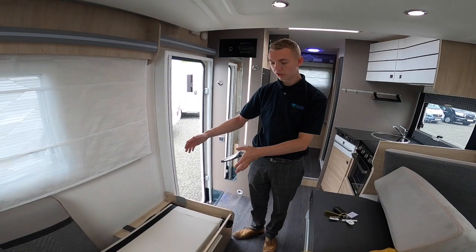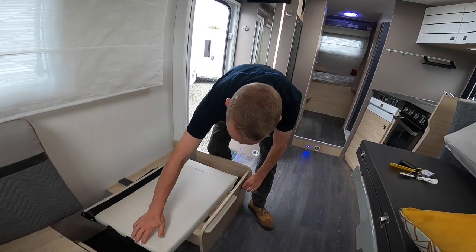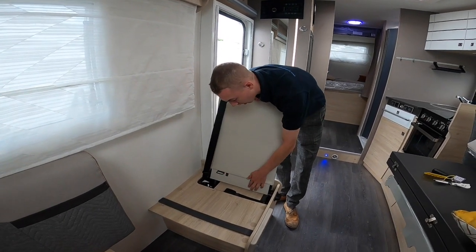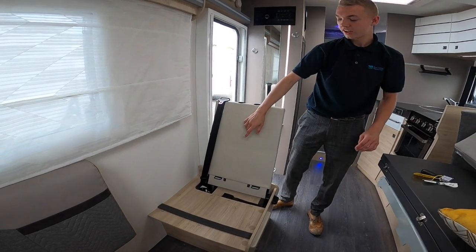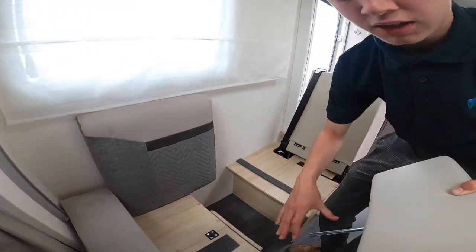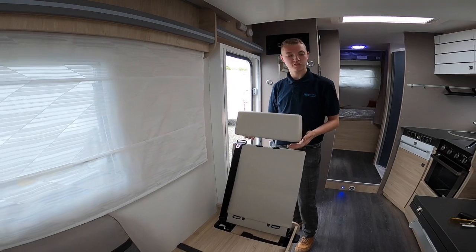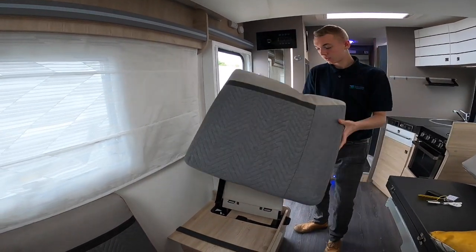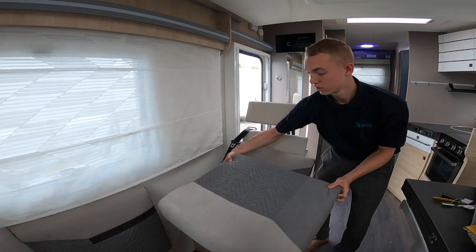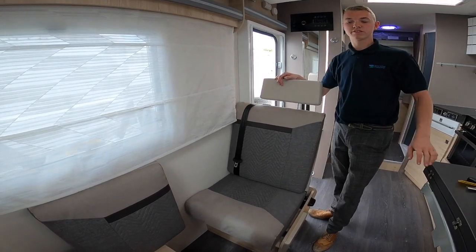To make your smart lounge up, you've got one on each side — remove the cushions, pull the black lever back, and when pulling the seat backrest back you'll notice ISOFIX points so you can connect car seats. There's a headrest which just clips on. There are two buttons to press to release that, and you'd use the backrest and the smaller base cushion to form a forward-facing travelling seat which an adult can fit on perfectly.